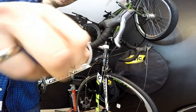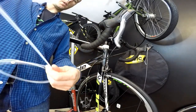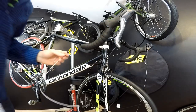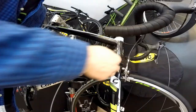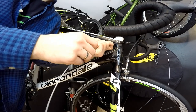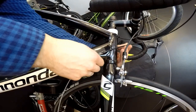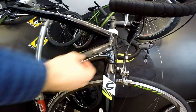The housing comes from inside the brake housing and is now in place. Next is the long-nose ferrule — I'm checking that both are the same length, yes, no difference for right or left shifter or front and rear derailleur. I push the cable through this ferrule, and the ferrule goes onto the housing — make sure it goes all the way in. It then goes into the cable stop on the frame.